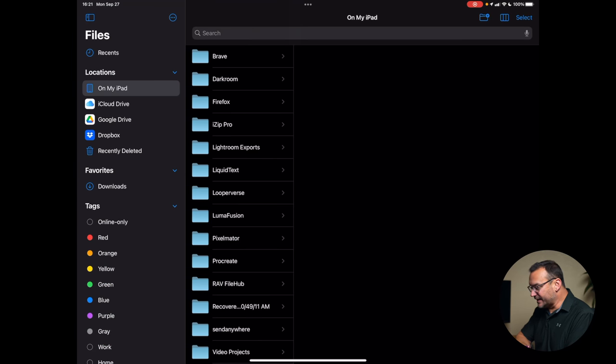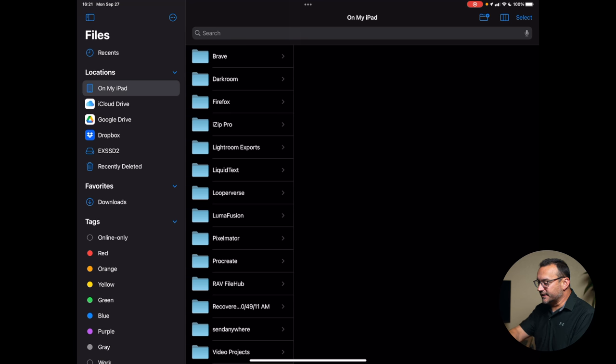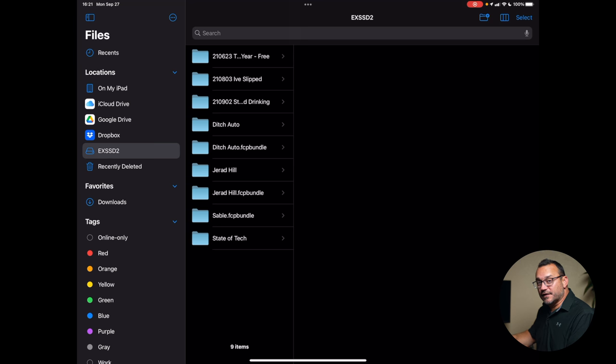Let's take a look at connecting a hard drive directly to the iPad. I have an Asus enclosure that is USB-C, and I put an NVMe drive inside of it. I just need my USB-C to USB-C cable and plug it right into the USB-C port on the side of my iPad. I'll open up the Files app, and within a couple of seconds I should see my drive showing up on the left-hand side. It can be a little finicky — sometimes it's best to open the Files app before plugging in your solid state drive. And there it goes, it finally showed up. I can tap on that and now I'm accessing all of the files on this SSD.